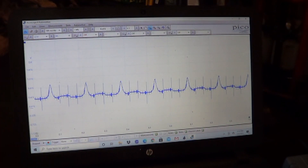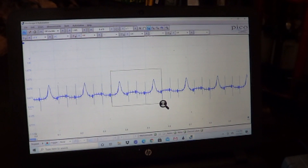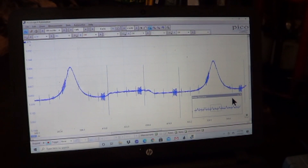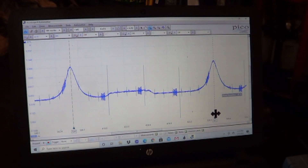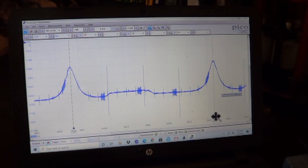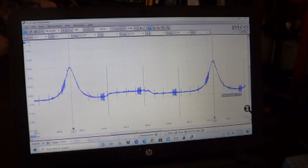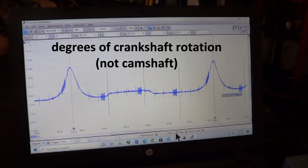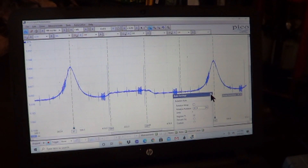I kind of have the pattern I was expecting now — let me zoom in. I'm not going to try to explain this because I cannot claim to be an expert at all, but I do know that you can drag these rulers over and put one on top dead center and the other on top dead center. I had to change that to 720 — it pulled up as 360 automatically and I just clicked and changed it to 720. That changes it into degrees and Pico does the math for you automatically with regards to changing it from degrees of camshaft rotation. Down here in the rulers you change this to four, and that kind of shows you what your four-stroke cycle should be.